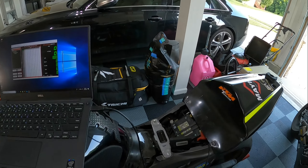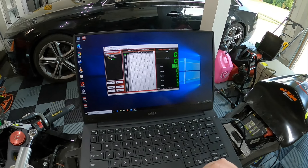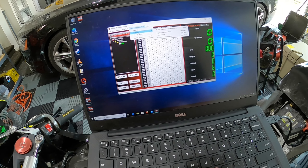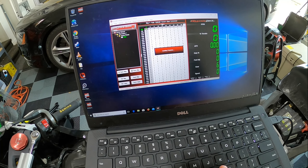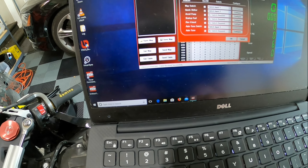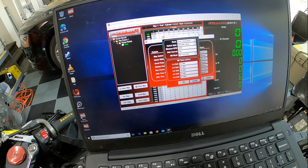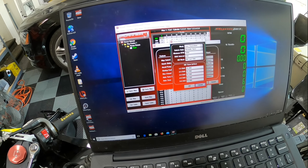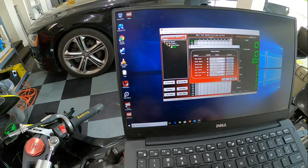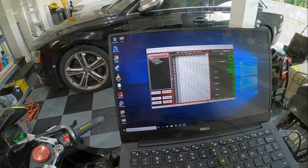Haley here again, just finishing this up. I've got the laptop plugged in to the power commander and the bike is on. Now I'm going to enable the quick shifter — I'm not going to do a screen grab or anything because it's super easy. Just go into Power Commander Tools, Configure Feature Enable. You'll see there's an item for a quick shifter. Just turn that on — it's already set a switch input to three and four on the pins we talked about earlier. This is how it comes pre-configured. I'm not going to change anything right now. I've heard the stock setting works okay, so we're going to go give it a ride now.